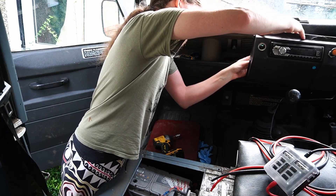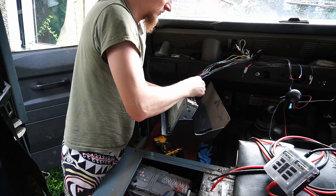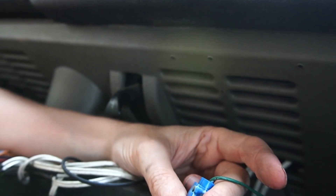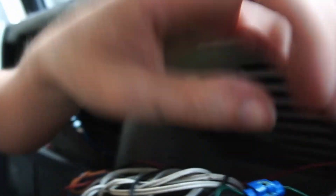The wires in the back of this are tight. Rant time: don't ever use scotch locks. These things snap over one cable and provide a jump to give you another cable coming out of it. They are, as you can see with this one, a bit dangerous - they like to burn and melt if you pull anything more than an LED's worth of power through them. I didn't even know this one was here. Just please don't use them, they are a pain.